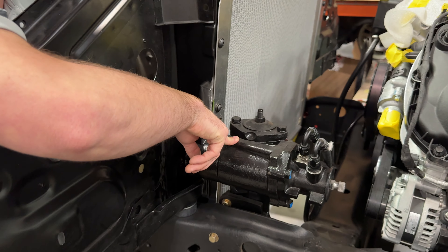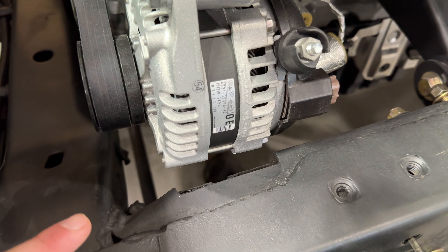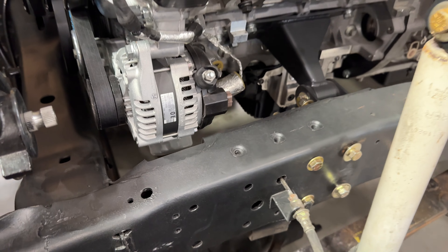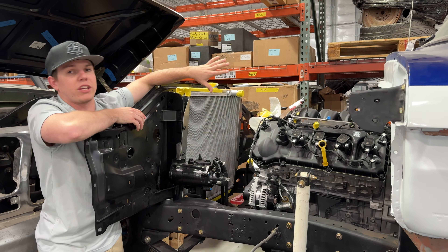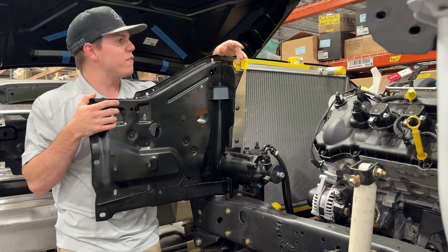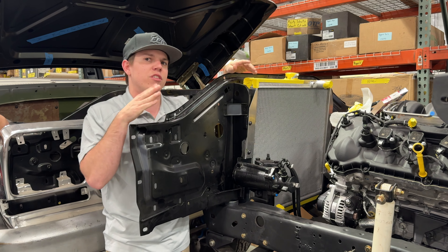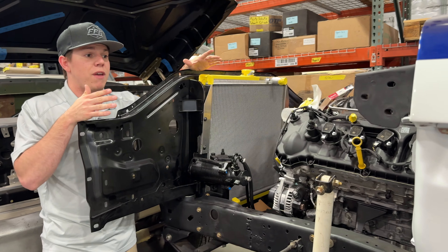This is a replacement but same style as a factory steering box on a factory frame rail. As you can see, we cut out a small chunk for the alternator — quite literally the smallest of little shims to get that clearance. It would have cleared normally; it's just giving you a little bit of space in case you need to get behind it. Short story is it fits, which is really cool and kind of crazy. What's not on there now that will be is our FFG headers. So this is basically the fat fender garage motor mount kit, our aftermarket headers. And then this is a replaced core support — the OEM one is a little bit crappy, pretty common on these trucks that it'll be bent or twisted. Normally we'll replace it with something new. We tried to set ourselves up where everything falls in the same system, so whether it's a Porterbilt frame or a factory chassis, as long as you're using our parts or our system, everything should go pretty smoothly.